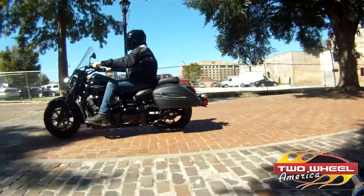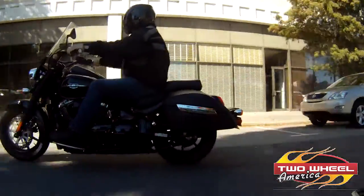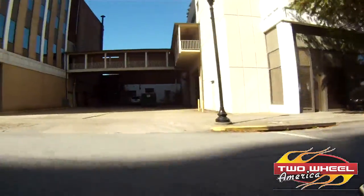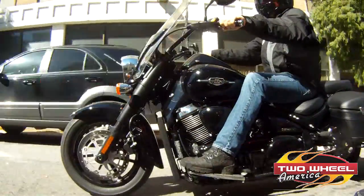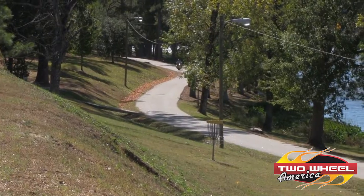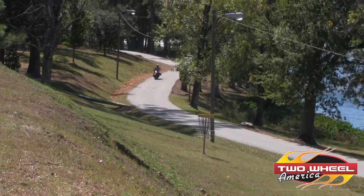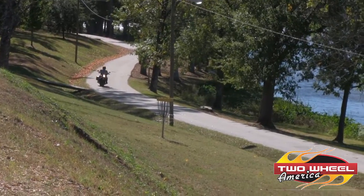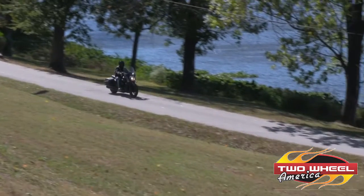In our riding test, we found the C90T produced a ton of torque all the way through the entire gear range. And the reason for that is Suzuki used the same dual throttle valve induction system on this bike that it used on the GSX-R race replica bikes. And that induction system delivers a smooth and fuel-efficient throttle. And all that power is pushed out through the shaft drive onto a 130mm 17-inch front tire and a 200mm 16-inch rear tire rolling on cast aluminum spoke wheels.